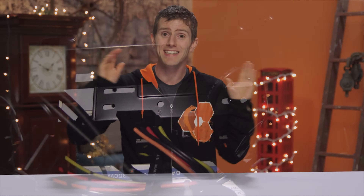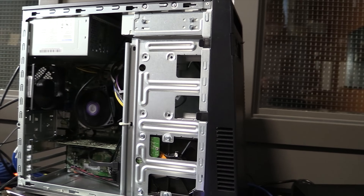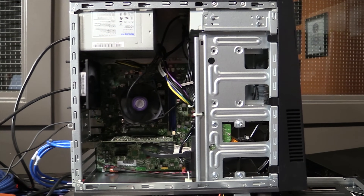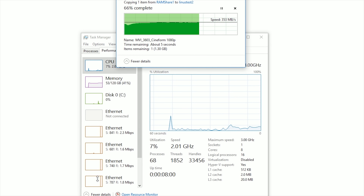In the end, we did manage to get Johnny's boot SSD from his Skylake personal rig running on my X99 test bench, but we were stuck with that Lenovo box with the Core i3. Making that change — and we actually switched back to my cheaper network cards at this point since the i340s didn't seem to be making a difference — resulted in a much faster and more consistent transfer, just still not what it should be capable of.